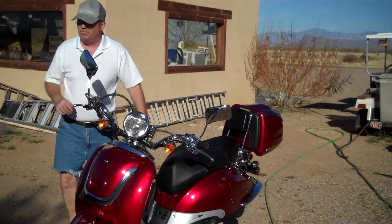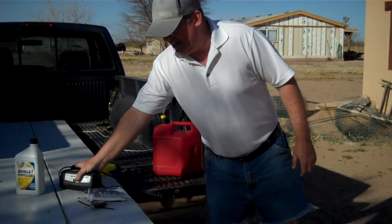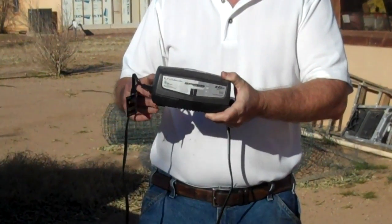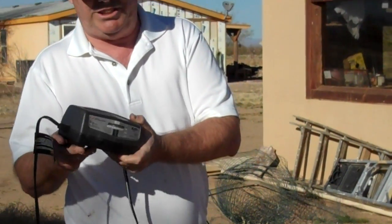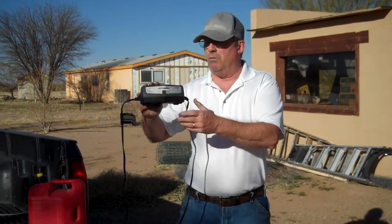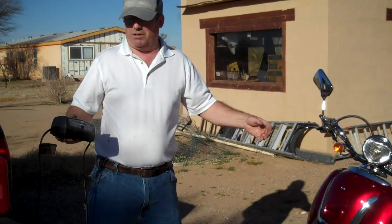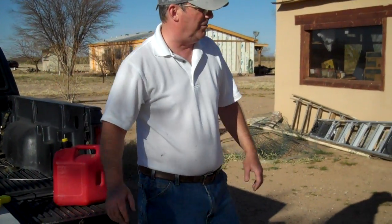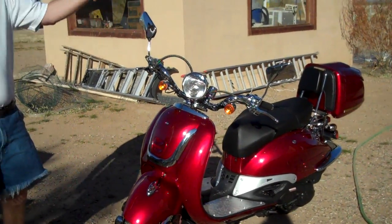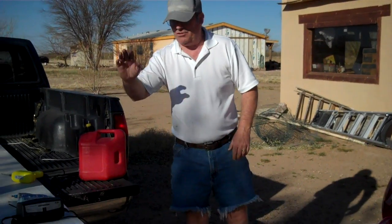As soon as you have access to wherever they put the battery — like underneath the seat in this case — you'll want to take that out, fill it up with the provided liquid. You don't want to jumpstart it using Uncle Mel's F-250 Ford pickup truck. You'll want to beg, borrow, or steal just a trickle charger like this. Here's one from Walmart, cost $19.97. Well worth its weight in gold — in about 2 hours and 40 minutes it brought this battery to a proper life, and that way it'll run for probably 3 years. Arizona's rough on batteries. If you'd jumped it with Uncle Mel's F-250, it would last about 1, 2, or 3 months.